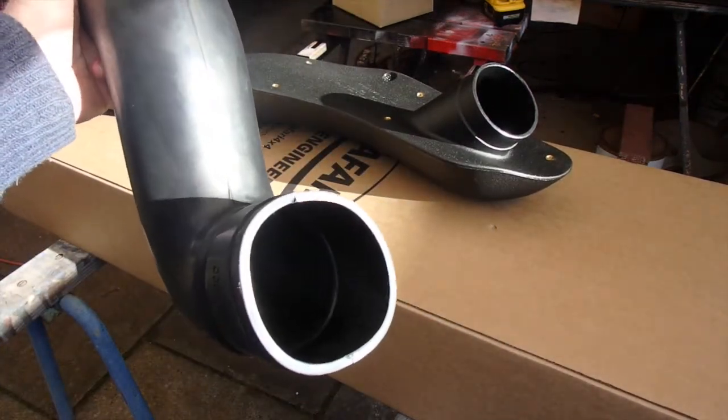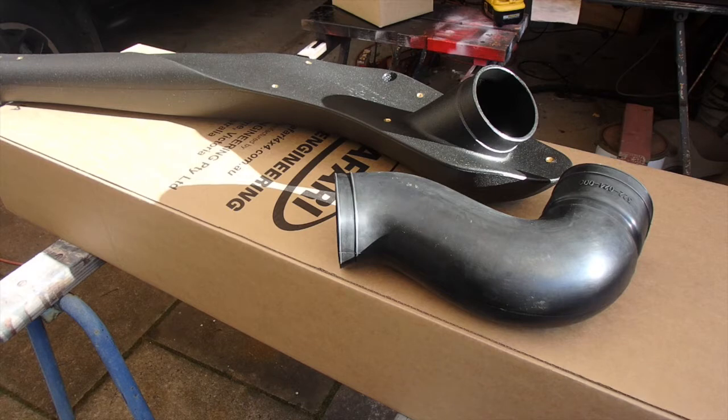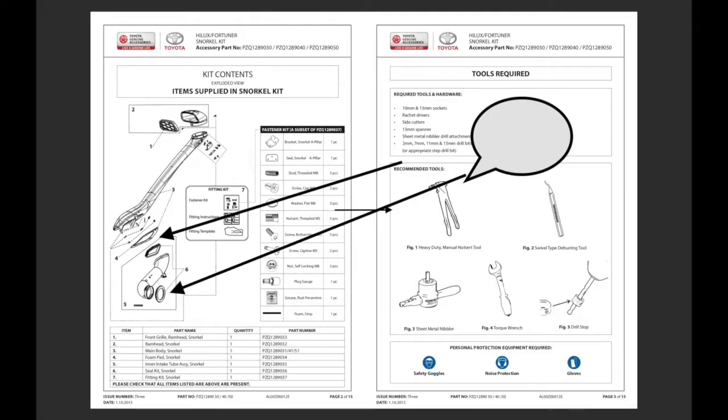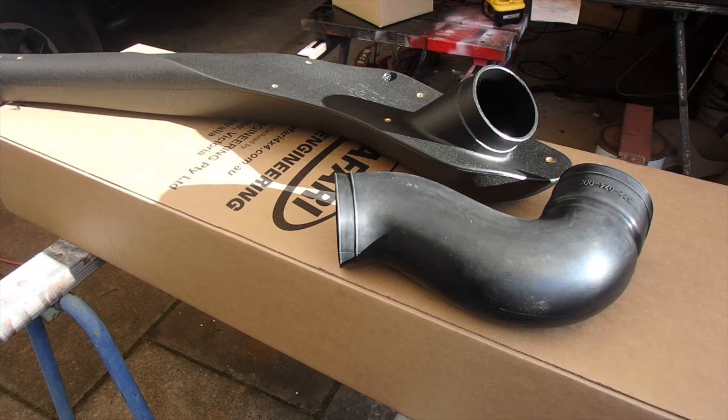So it comes with this piping here — a pretty solid piece of piping for a 2.8 litre diesel. Now the Air Max model has even larger flows, and it requires a bit more modification to the air box. The reason I chose Safari is it's basically in one piece. I looked at the Toyota snorkel and it's in multiple pieces with a foam seal and two other types of seals — just more places for something to go wrong. So I think this is going to be a good fitment. Hang in there if you want to watch me fit the snorkel and cut big holes in my car.